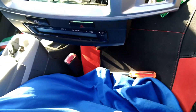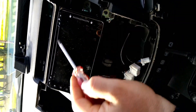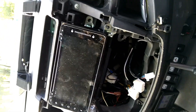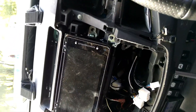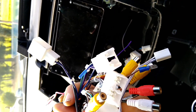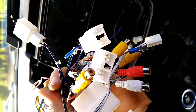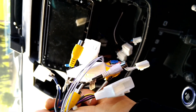Now it's time to take the head unit out. You're going to undo the four screws holding it in. If you have a standard head unit, everything is basically unplug and plug it straight into the harness that is supplied by EC Off-Road. All these plugs can only go in with the correct matching male-female socket — don't force anything because then you'll have problems.